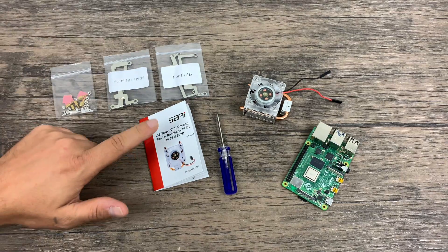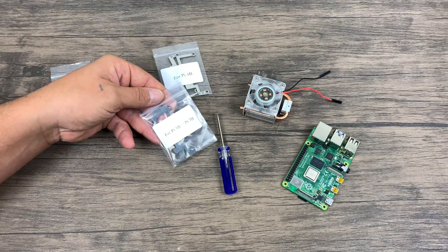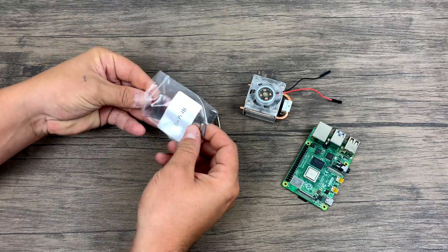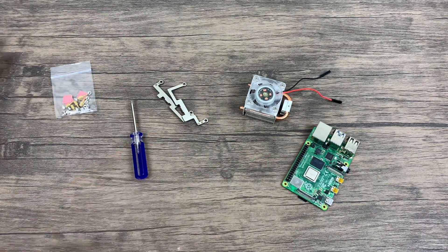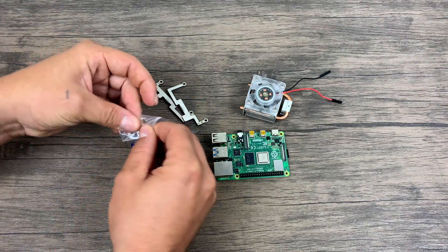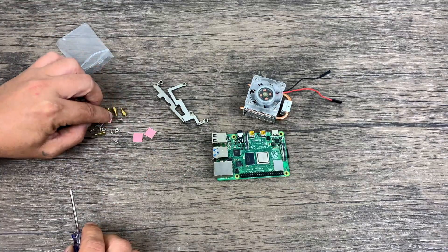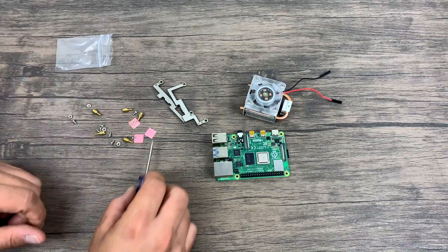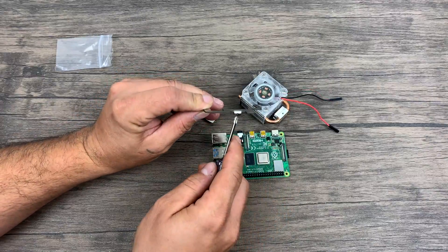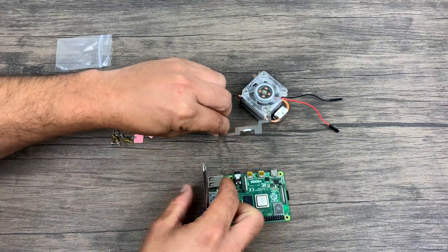Assembly on this unit is very straightforward. It comes with full color instructions, so you're not going to get lost. It also comes with brackets for the Raspberry Pi 3 and 3B+, also for the Raspberry Pi 4, and that's what I'm going to be testing out in this video. I have a Raspberry Pi 4 4GB model, and these things do get quite hot without a heatsink. Inside of the box, you'll get all the mounting hardware you need, plus some thermal conductive pads. The first thing you want to do is grab the mounting brackets and just make sure you have the correct one for the left and right side — they are not interchangeable, they only go on one way.